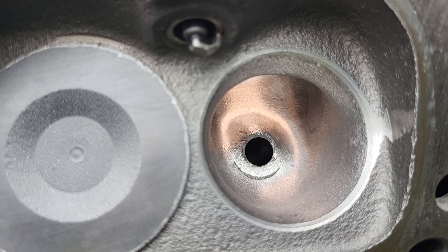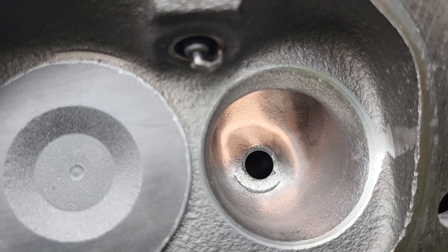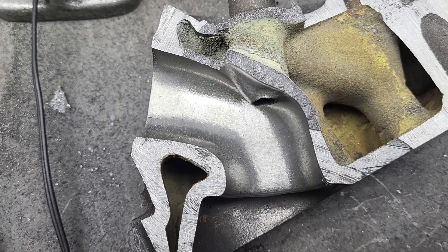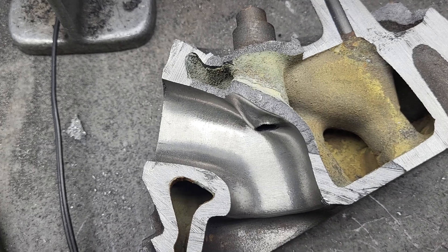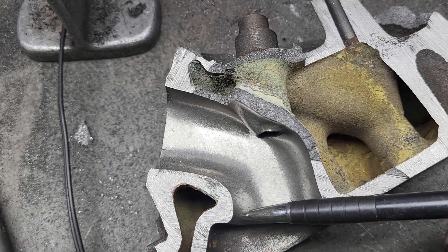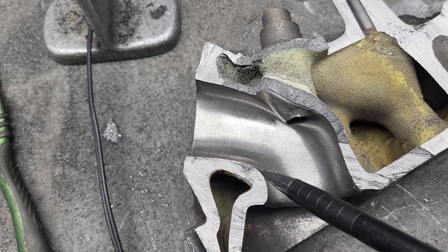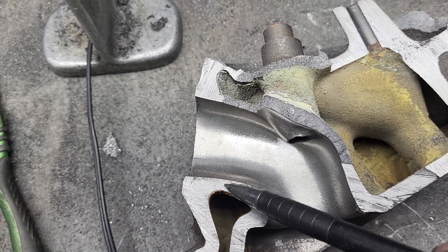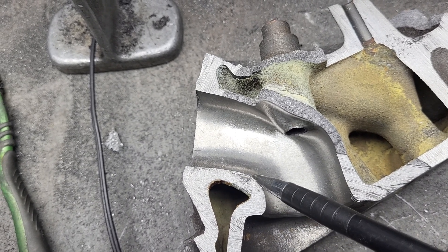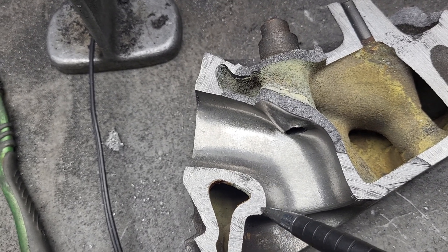But it would be nice to keep it a practical shape that actually would be able to be used, so I'll keep that in the back of my mind. We should actually take a look at the cutaway of the exhaust port. We've got quite a bit of metal on our short side — we could do a lot of work to this. Now that I've got the throat even all the way around, I'm tempted to move the short side because it looks like this has given us a lot of problems right now, because unlike this one, it's sticking out into the bowl.